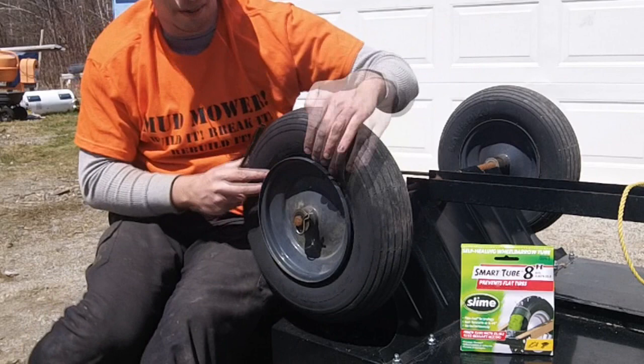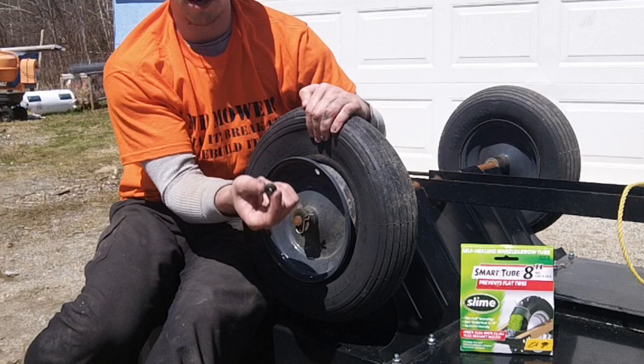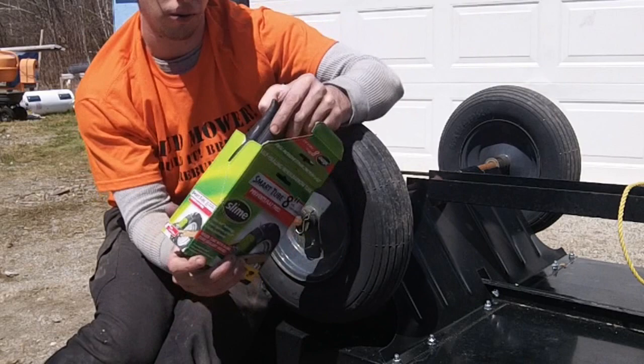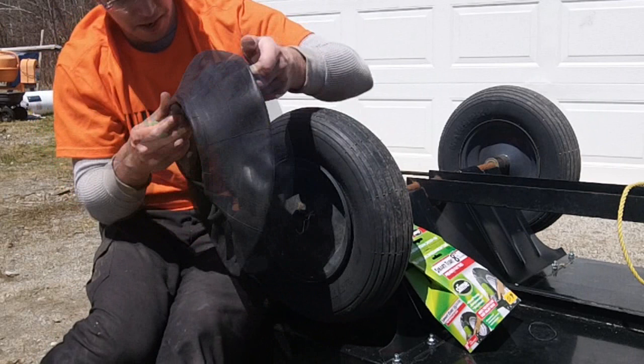Taking a little bit at a time — and as you heard, it let loose. The whole tire is loose now. One thing you're gonna have to do is pull out the nub from the valve stem we cut earlier. This may end up in the bottom of the tire, so be aware of that. From here we're going to open up our Slime tube container — you'll find the Amazon URL in the description. Pull it open and make sure it lines up as the right size.